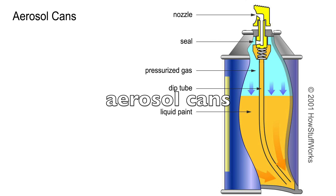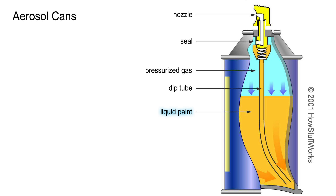In preparation for talking about automotive spraying, let's review how rattle cans work. The nozzle, like everything else about the can, is disposable. This is a problem because ideally the nozzle is a precision part. The paint is dispensed by pressurized gas contained within the can itself. The paint is a one-part liquid because it needs to remain ready to use for an extended period of time.